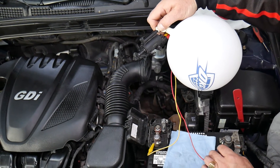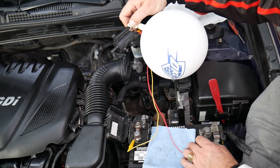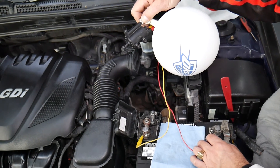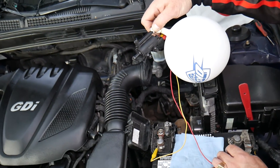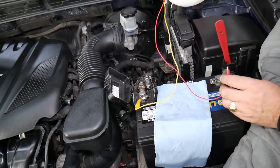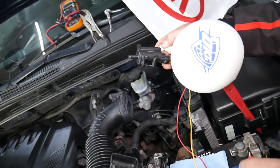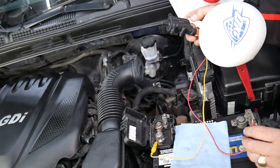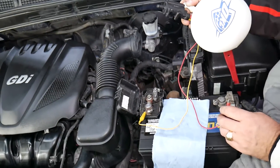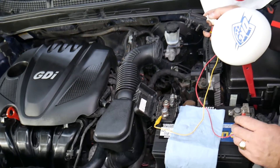That's a good valve — it closes good and opens on time. We can also test it intermittently, which is how the engine computer does it with short signals. When it stops, it holds pressure; when we open it, it releases. That's a good working valve. In some cases it may be a sticking valve, so I recommend testing it for at least three minutes to make sure it works every time without any problems. Hopefully this video is helpful — thank you for watching and see you next time.